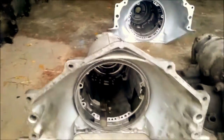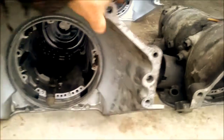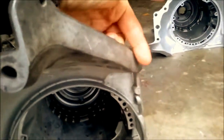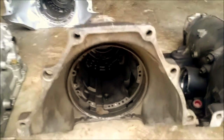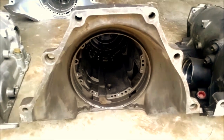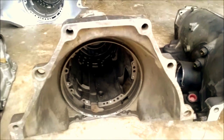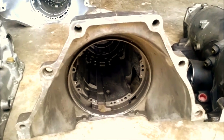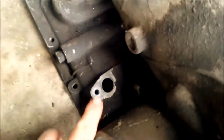We also had the 700s - the V8 case for the 700s. This is the V8 passenger car two-wheel drive, and you'll notice it had the little holes right here for the thinner passenger car dust cover. The 700s would also have the V6 - not the 4.3, but the 4.3 would bolt up to this V8 case. The small V6 and the little 2.2 liter four cylinders would bolt up to what we call the flat top. These are 700s because you can see it has the small electrical connector and the place for the cable to go in.